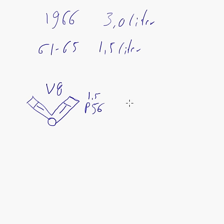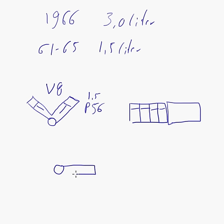Looking from the side, the engine would look something like that. And the V8 would have four cylinders in each section of the V. Doubling that would mean adding another V to the end of that, so we'd have eight cylinders in total in each section, making 16 cylinders. However, a long engine is bad news, because you've got a long crankshaft supplying all those cylinders. Having eight cylinders in a row would have a very long crankshaft that would twist, and it would be very difficult to manufacture and very difficult to keep straight all those twisting moments and pressures on that long crankshaft. Bad idea.